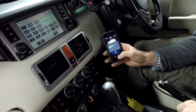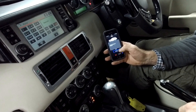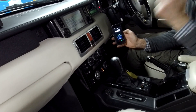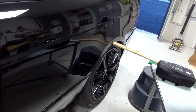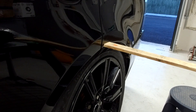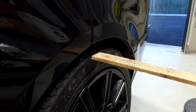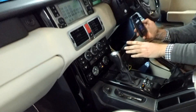Let me try and program it now — update changes to the vehicle. It was literally just a time-since-ignition-on thing. So now we're programmed. We've got to have the car running to do this, so I'm going to start the car, leave it in access height, and it should change height by itself to the new settings — it should go up by exactly 52 millimetres. There we go, that's gone up and we're still in access mode.